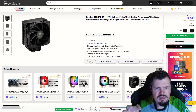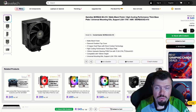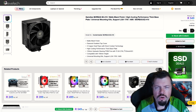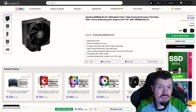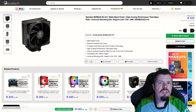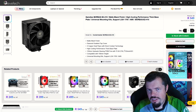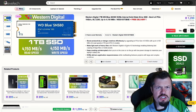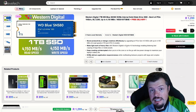Normally with upgrade kits we do get pretty decent CPU coolers, and the included cooler will be okay, but I wanted to upgrade it slightly. You can increase the wattage through the i5-14400F — it doesn't really have hardcore per-core overclocking, but it allows you to increase the power throughput. When you do that it increases heat, and this upgraded cooler will keep it cool so you get better boost clocks out of it, defeating the issue of single-core performance.